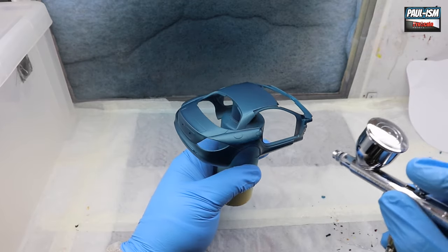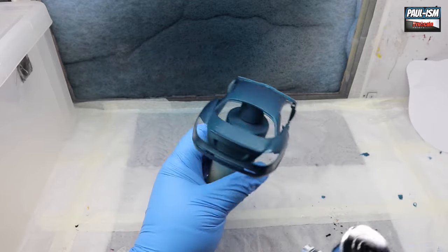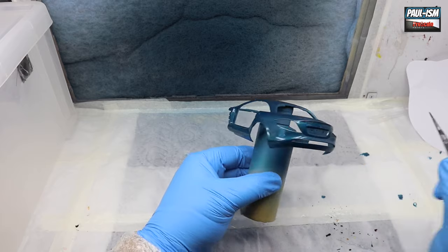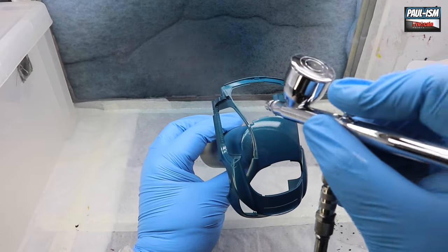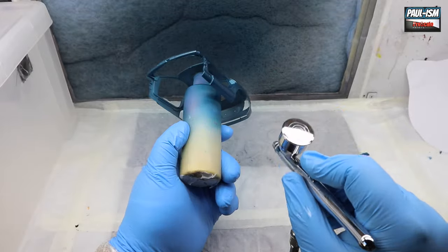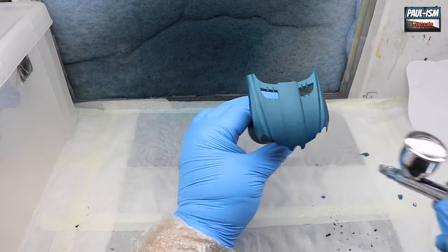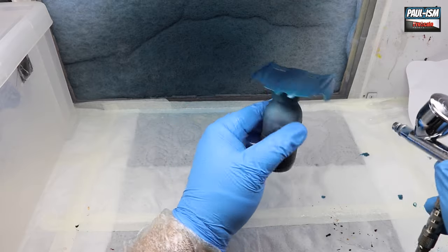We're going to put down a nice semi-gloss first coat at 22 PSI. My Benchvent booth is on, my skin is covered, and I've got my full-face Scott respirator on. I'm on my own in the room — follow those precautions and you'll be just fine. I've got my plastic case where I can put the body in to stop dust landing on it. On the first coat, we want a nice semi-gloss clear coat, making sure we've got all the recesses, nooks and crannies, all the sills. Once we're happy, that goes back in our plastic box for five minutes to flash off and go tacky.